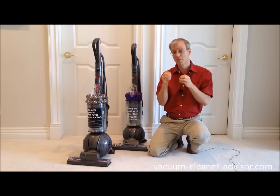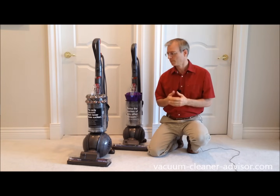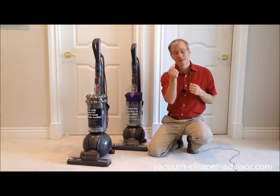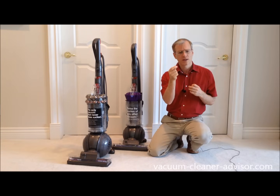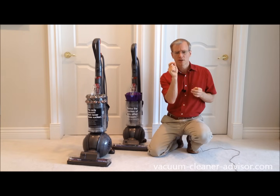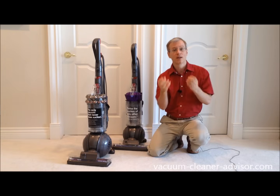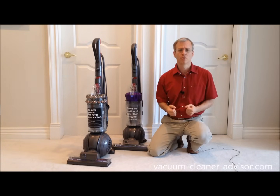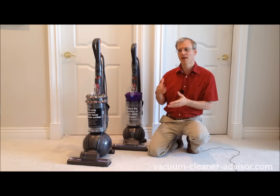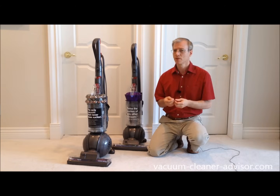The really small cyclones generate much faster spinning air and therefore more centrifugal force, resulting in particles being removed down to 0.5 microns — so this system doesn't have a pre-motor filter. One thing Dyson engineers ran into was that with a really small cyclone the tip is also quite narrow and dust can get stuck in there. So they've got a system where those cyclone tips are oscillated at 350 times per second, essentially shaking out any dust and debris. Dyson report that they run 10 years of dust through these without any appreciable loss in suction.